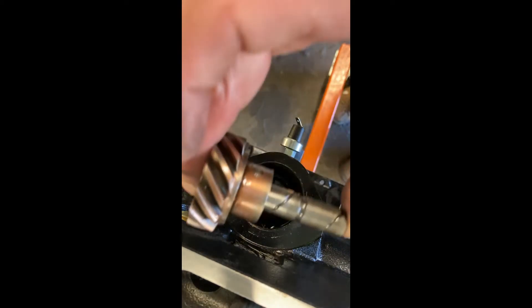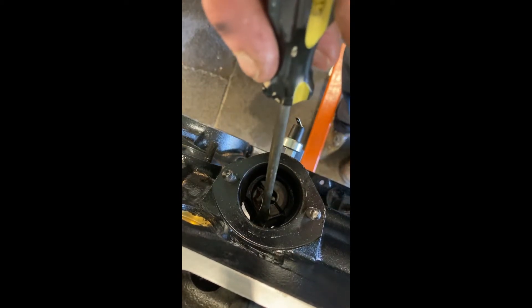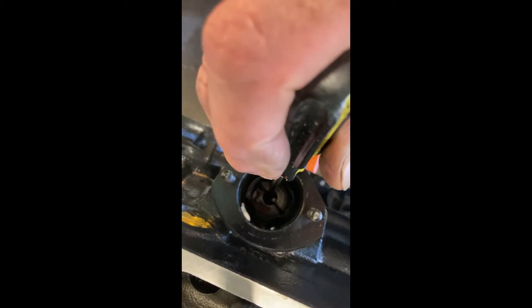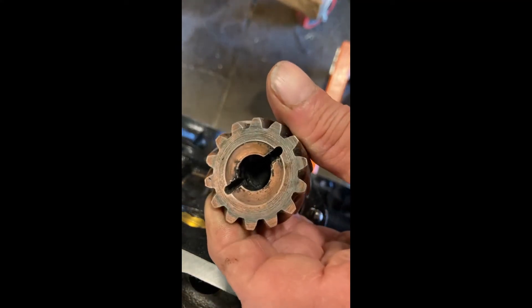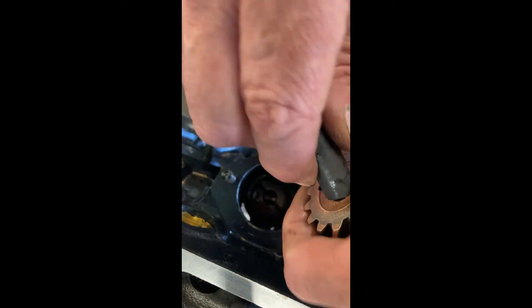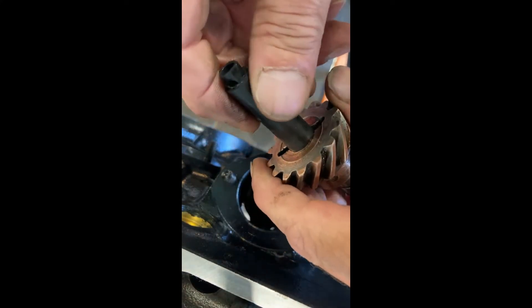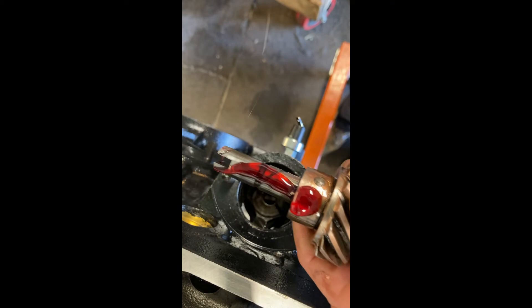Now I'm going to try to install the gear. You can see down here - that's the gear from the camshaft, and that is the oil pump. You want that oil pump turned to line up at the bottom of the gear in that slot. I was trying to put this in but you drop it in there and you can't control it. So I have a little piece of rubber hose here - I'm repurposing it. I'm going to push it into the center of the gear. Before we put this in, of course, we're going to put some lube on it. Put some on the gears.